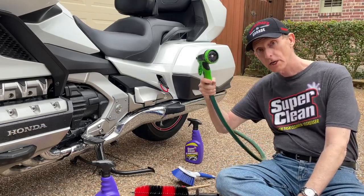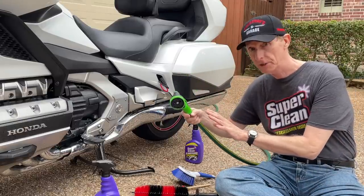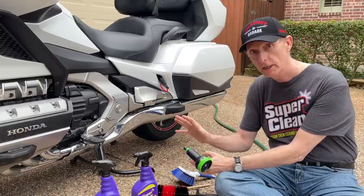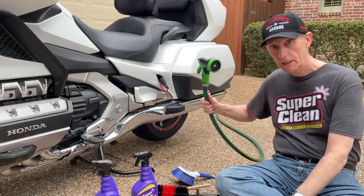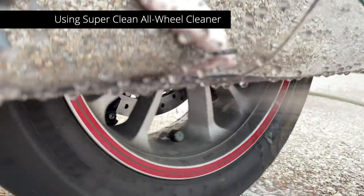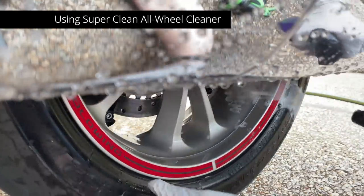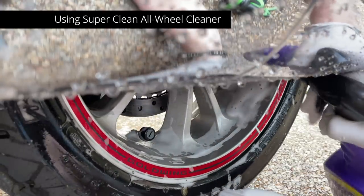I also have a garden hose, because once you finish the cleaning, you let it sit for about 30 seconds. You do not want to let either of these products dry on your wheels or tires. So you want to make sure you rinse it off really well after you've cleaned the wheels. I've got my garden hose ready with my little sprayer — I can kind of spin the wheel as I rinse it. This wheel is not as dirty as it usually is. You also want to make sure you're wearing gloves to protect your hands from these chemicals. They can be rather caustic.